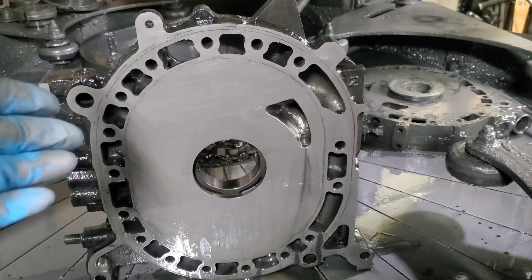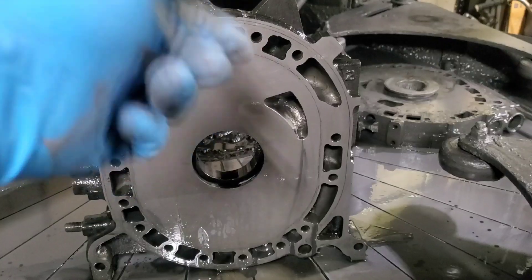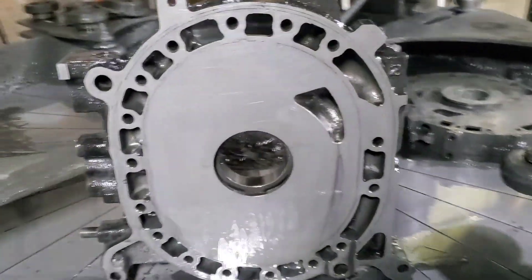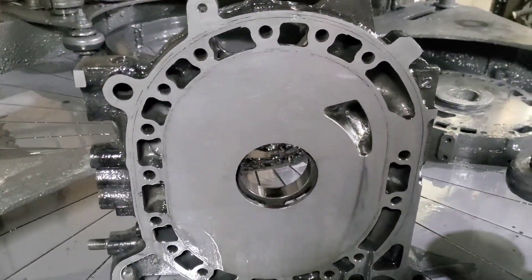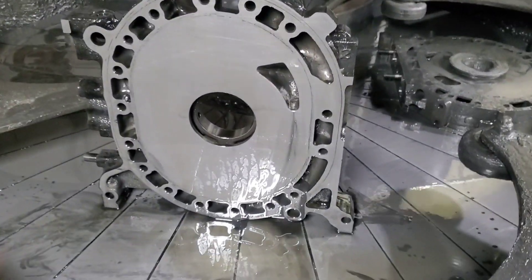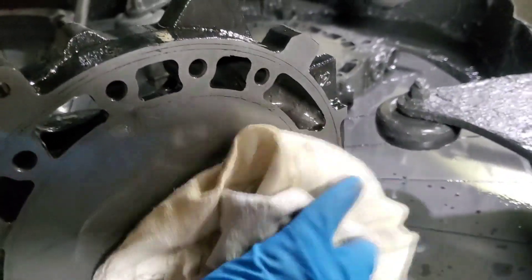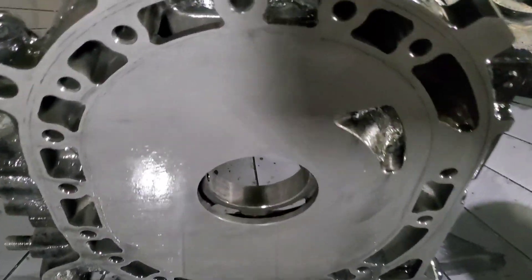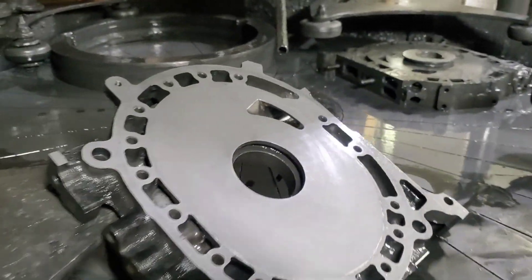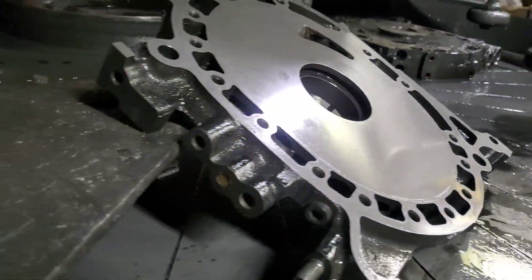You're probably not just going to run out and find a 12A front iron with matching CNC porting easily, and we were able to bring this back to reasonable specs. KMR, lapping, Mazda tricks. If anybody needs the service, it's available on the websites — we do some rotary machine work. Gave it a quick wipe-off so you can see: nice and flat, shiny, no damage anymore. Brought that one back to life. KMR — let us know what you need lapped.